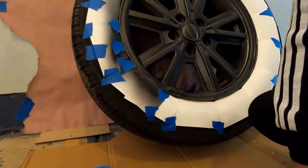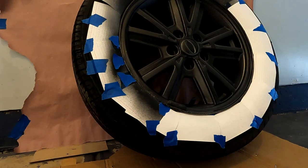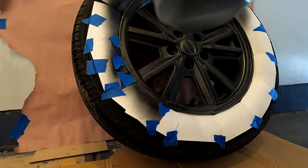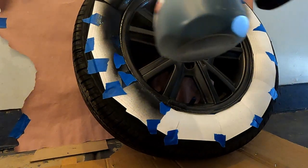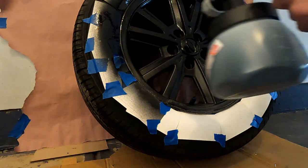Most importantly, we can go ahead and begin the second coat, which we're gonna lay on way thicker than the first one. So go ahead and turn on your gun, and you can go ahead and start spraying. This time, we're really gonna focus on those 50% overlaps, which I'm gonna go over right now. What I mean when I say 50% overlaps is that the top half of your second pass should overlap with the bottom half of your first pass.